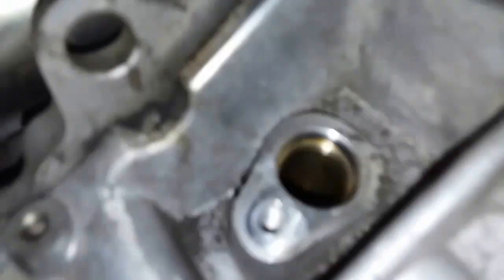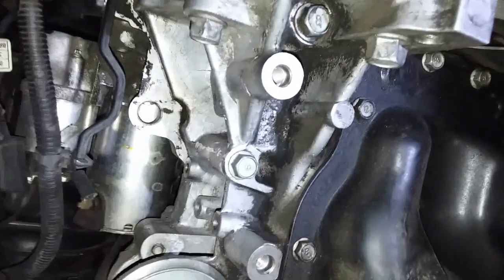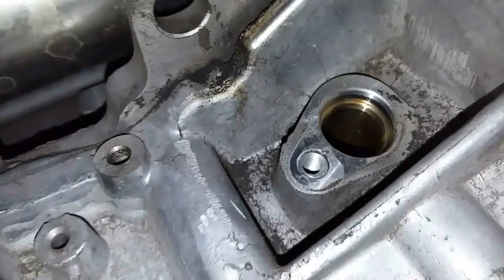After you remove the original sensor, we're going to go ahead and install the new one. Get on the creeper and creep all the way up in here. This sensor goes right in there — it's located right in between the transmission and the engine, right next to the oil filter, right on top into the side.